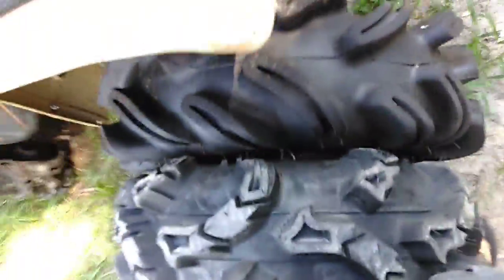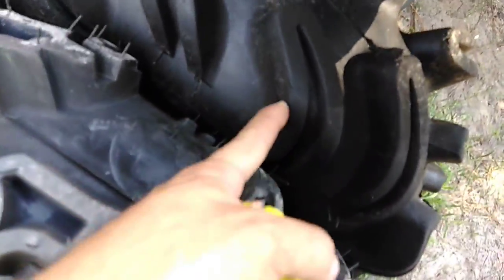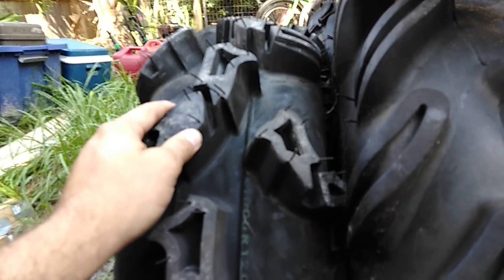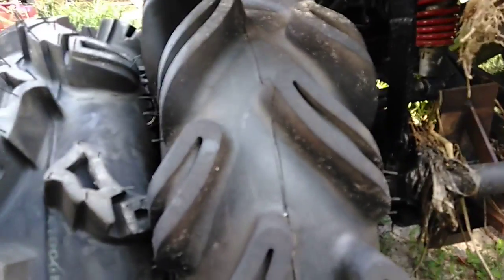Also, these tires are a little broken in. They're not that old. Here's next to a 31-inch Outlaw. See the tread design? It's a lot more open, which is good for cleaning out. But it doesn't have this massive corner height, which is, in my mind, what makes an Outlaw paddle so well. These Outlaws have 4 psi in them. A lot taller, obviously, they're mounted, but these tires do have a lot more tread in the center. So like climbing out of a hole and biting, these might be a little better, but as far as paddling through thick, soupy stuff, Outlaw's going to win every time.